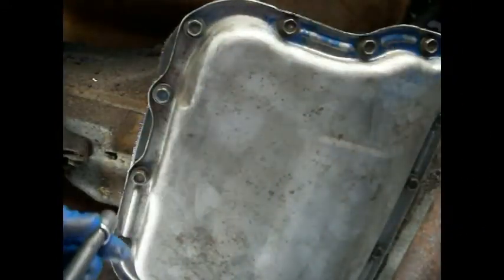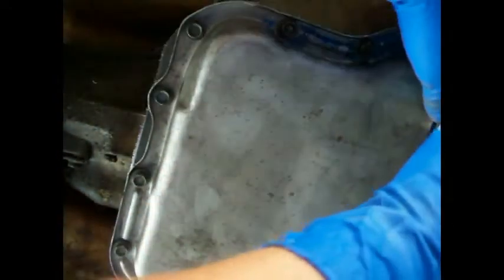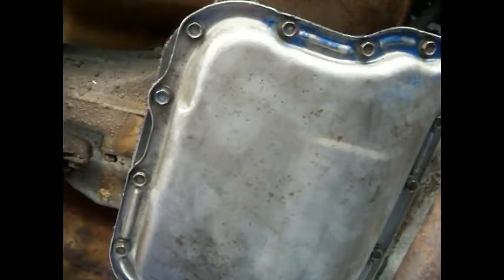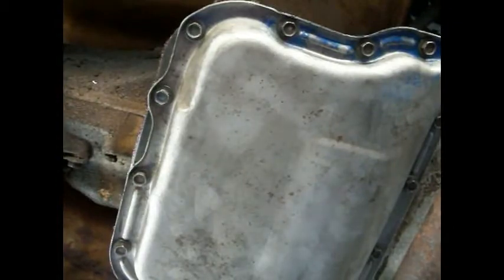Well, I just looked over and realized that thing wasn't recording, so I don't know where it stopped recording, but I'm just going through here and snugging all these up. These have got to be torqued at 17 foot-pounds. So look. Okay, I think I need to put the 17 foot-pounds right up here. And 17 is just below 20 on the scale here.